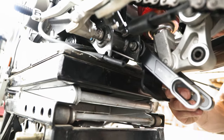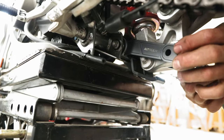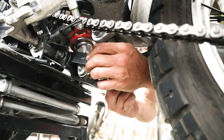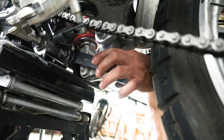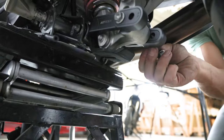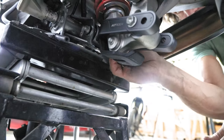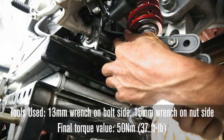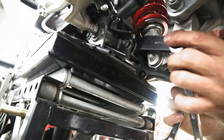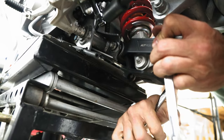I want to set the bike in the tallest position for the first setup, so I find the two-dot hole — that's the first bolt hole, configuring single dot, single dot, single dot. Go down to install with the pre-greased OEM bolts. Just like removal, you need to lift the linkage. With the free-floating swing arm on my boot, I grab the shorter bolt for the front, slide it up and in, then come around and align the bolt hole to the frame and pass it through the bushing. Get the nut started — 13 for the bolt head, 15 for the rear nut — and tighten down. These nylocks don't need any Loctite; torque to spec.